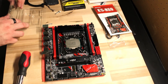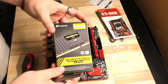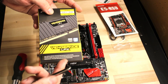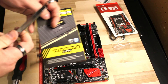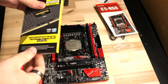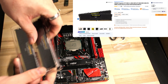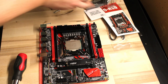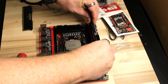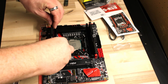It's important to note that I'm building a lot of this on the tabletop before placing the whole system into the case — it just makes it easier to build. Next we'll move on to RAM. I was able to pick up a 16 gigabyte kit — two sticks of 8 gig DDR4 RAM — for just about $40. This is standard RAM you'd find in any gaming system; we're not limited to server RAM. This being DDR4 3600, it's a little fast for our processor, but it'll scale back — so if you find a good deal on faster RAM, your computer will scale it down and that's perfectly fine.